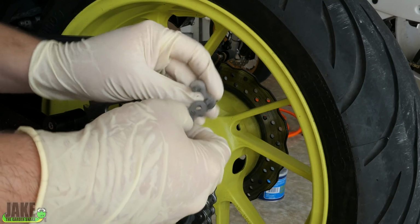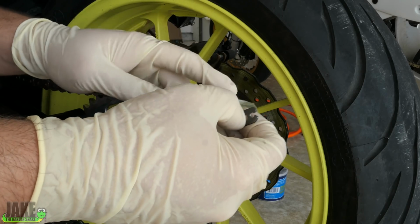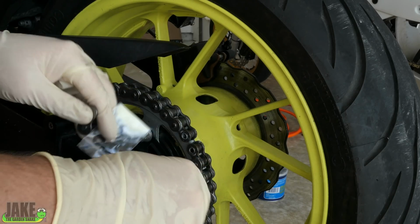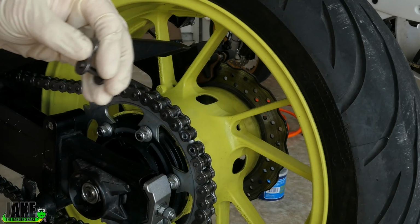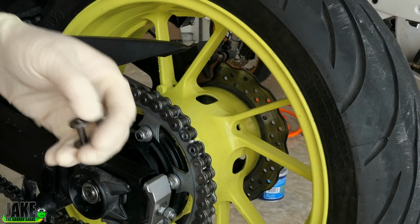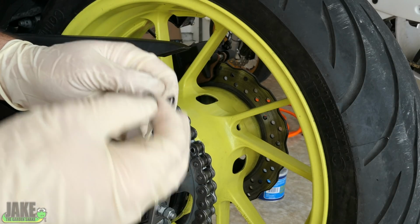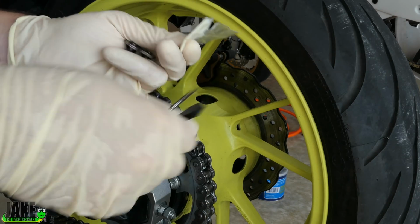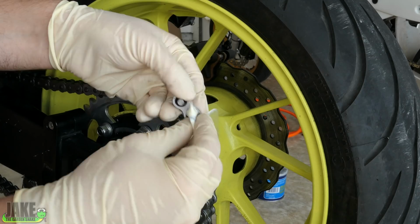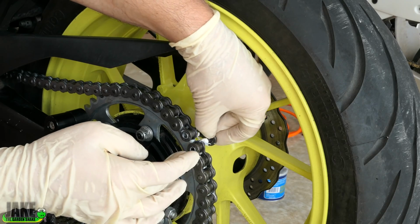Link here and the other side and this little clip and a bag with O-rings and some of the grease. And this grease is really good that it comes with because it's the same kind of grease that's already in between all the other links. So we'll want to put a silly amount on there, more than we need, and let it squeeze out what's not necessary. You'll grab two of your little O-rings and pop two of them on. Slice into our bag of grease, always cutting away from yourself like a good Girl Scout would. Not really one of those situations where you could have too much. Stick this in.